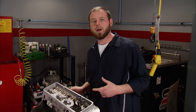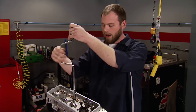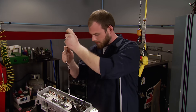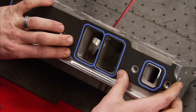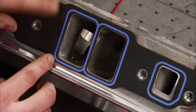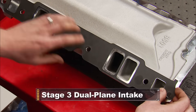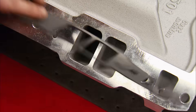You can correct your sweep area by ordering longer or shorter pushrods. Summit Racing can actually turn a custom set around in under 48 hours. Since we've got to wait on ours, we're going to get ready on port matching. We're going to be using the gaskets that come set up for these larger 200cc intake runners. Placing them on the head shows they're pretty close — we've just got a little bit of cleanup room to do. On the other hand, most intake runners actually come small so they can be opened up to what you want, and our dual-plane high-rise intake is no exception.